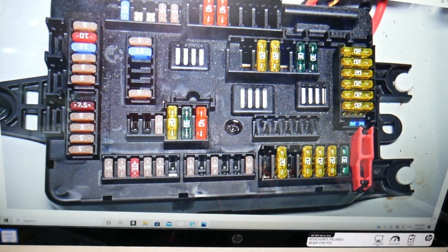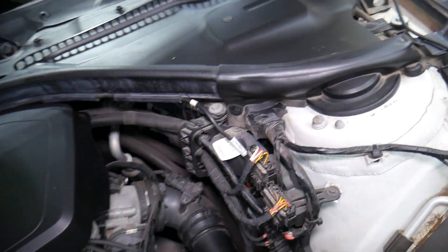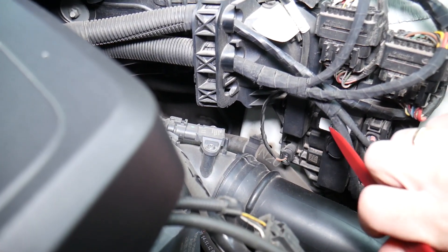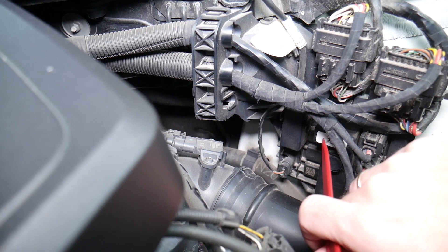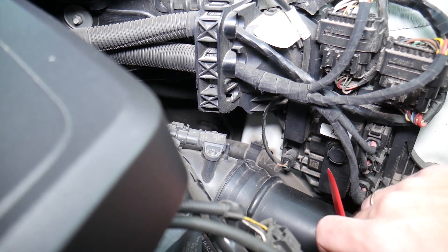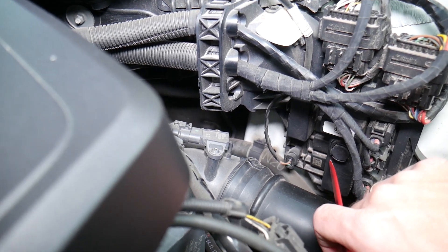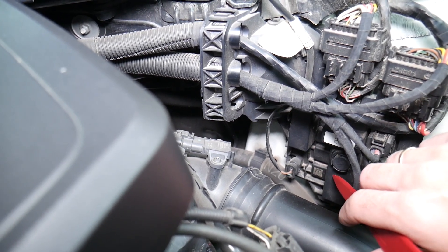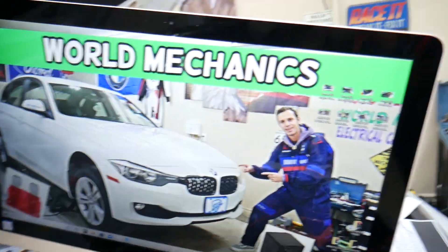Now there are a couple more hidden fuses that most people don't know about. On the driver's side by the shock tower, there's an electrical assembly. That rectangular horizontal piece has a fuse relay for the engine computer on top. Next to it there are five more fuses — the third one is also for the engine computer. It's a sealed box, and most people just replace the whole assembly. However, we've seen people open them, replace the fuses, and seal it back up — it's doable. We'll make a video on how to do that very soon. Hopefully this video has been helpful — thank you for watching and see you next time!